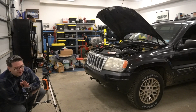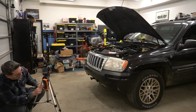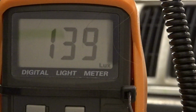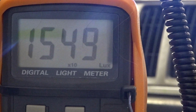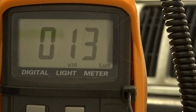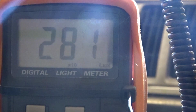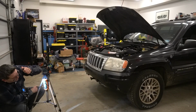But that's important because when we test the lights, we're gonna easily blow by the scale. If we just have it even on this scale right here, I believe we're gonna go straight to one when we do this. But if we were to change here, well, even this light's gonna blow by it. But you can see here, we can very easily go to a higher scale. So our times 10 is where we're gonna need to be.